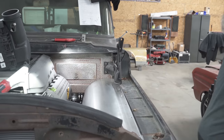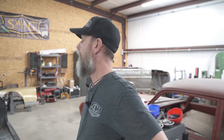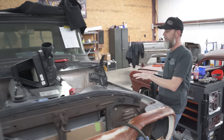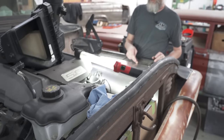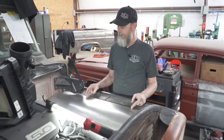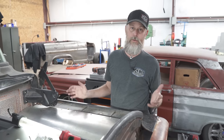So what do we have left on here? What's your next step? Next step on the fender wells will be to start spot welding them in, and then slit the two panels with the air saw till we can butt weld them together and metal finish them out. I'm going to try to get from about here to here so that I don't have to worry about pulling it out and doing it on the table and it moving a whole lot.